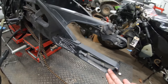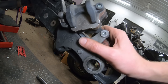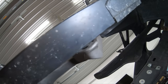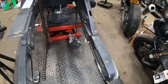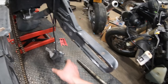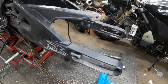These are the swing arm extension blocks I was telling you guys about. This is exactly why I do not like having these extensions on bikes, especially when installed by someone who doesn't know what they're doing. This brake caliper bracket right here is not even mounted to anything. There's a little bracket that's supposed to slide into the rail to hold it on the stock swing arm, but this is literally just sitting here, not connected to anything. I hit it with a hammer and it just came right out — the aluminum was all bent up. God forbid that had broken loose and the rear wheel locked up — that could have been really bad. I advise people to stay away from these aftermarket swing arm brackets because they can cause way more issues than they're worth.